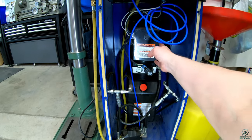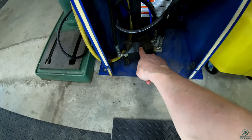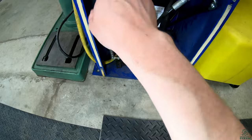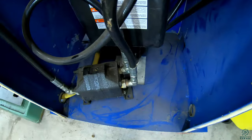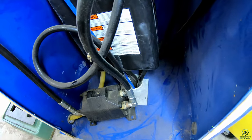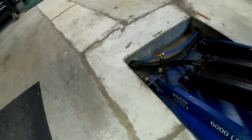Here's the inside of the console — it's pretty simple. There's a hydraulic pump, a hydraulic reservoir, a line that feeds into a proportioning valve which makes sure the same amount of hydraulic fluid goes to both lines, some splitters that go to the two different lines for each lift, and then down into that hole through the conduit which comes out just over here.